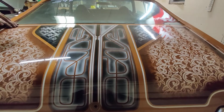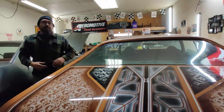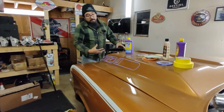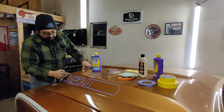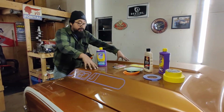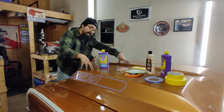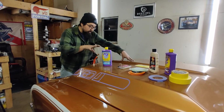The big panels were obviously easy. This was a stencil plate and this was the lacework. So we are going to do some lacework on the top of the hood, but it's going to be used as a main inlay versus a part of the panel. This isn't going to be this color on the side. I'm going to lay my stripe down, and then do one big main white panel on both sides. On the top, I'm going to do a white panel with the lace pattern right over the top. Then we're going to lay panels over that lace so that our striping and our other things are actually going to be laced once they're all taped off. So I'm going a little different there.